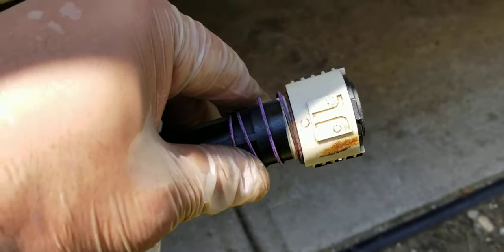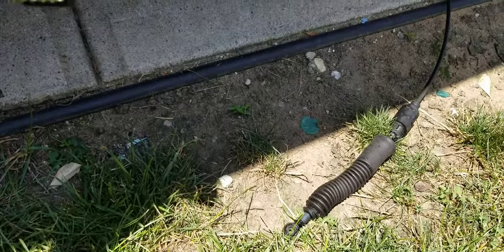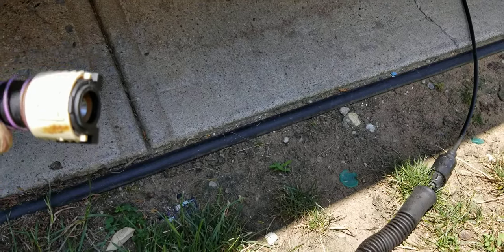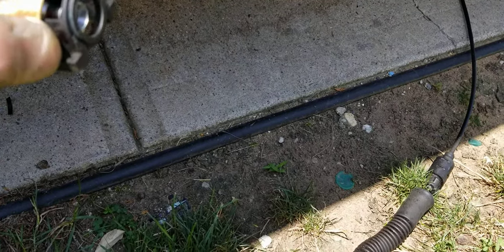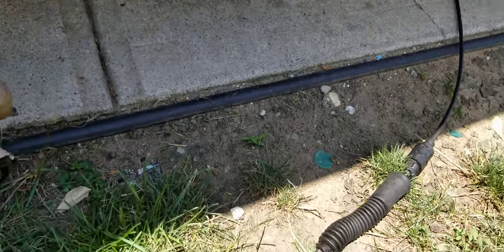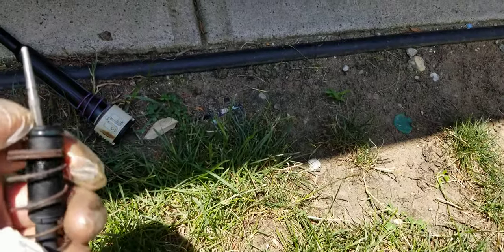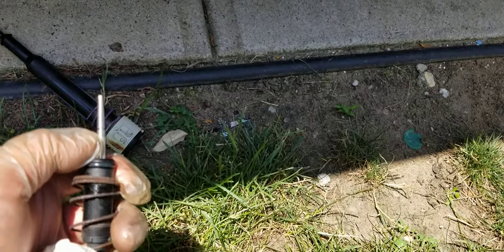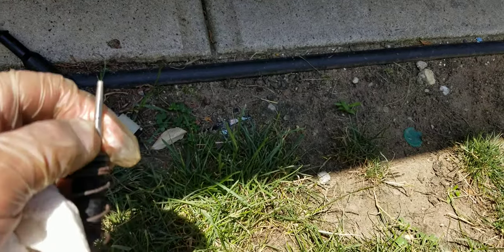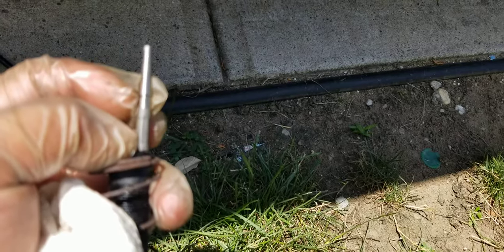Also, when you guys install this, here's my issue with it. When I installed this, I thought it's going to be a 30-minute job. What you guys want to do is lock everything in place before you guys snap it in. You don't want to just snap it in and then put it in place. Reason being is that E-ring — it's going to go all the way in, and when I say all the way in, it will bite all the way in. Instead of just stopping here, it will bite all the way in, and once it does, it's going to be too short to lock it into the little connector.